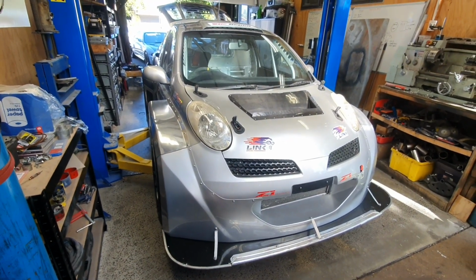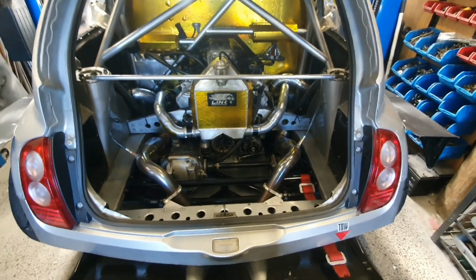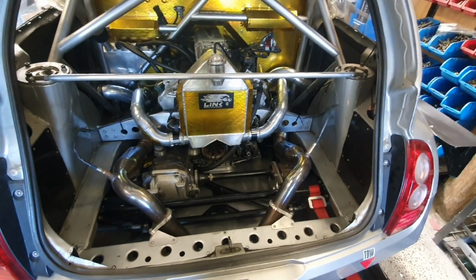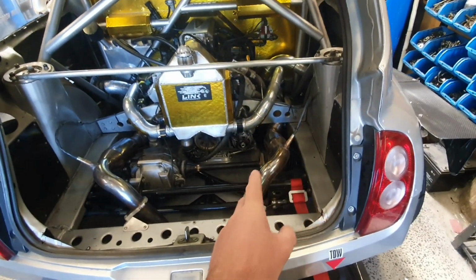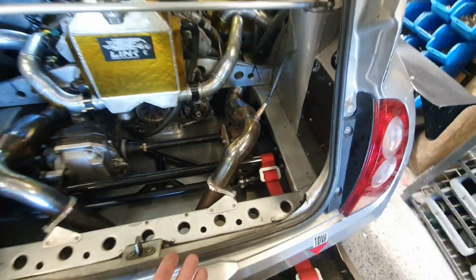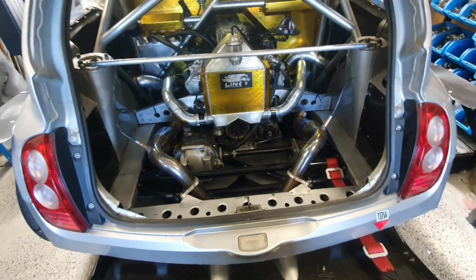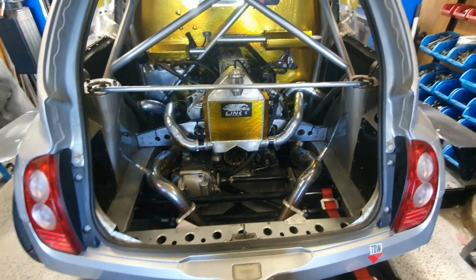But as they say, but wait, there's more. Back here where all the noisy things are, there's been some discussion about the exhaust pipes on this for some time in the background, not so much on the internet. You guys haven't really said anything at all that I can think of. It's a 2.5-inch system on each side. To be fair, it's about as long as your arm. It's really quite short. There's not much to it on each side, but graphs and charts and science and numbers, everywhere you look, it kind of indicates that that's probably a wee bit small.